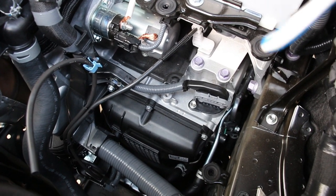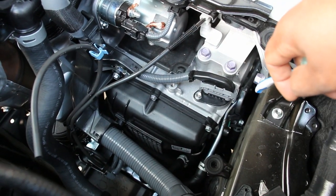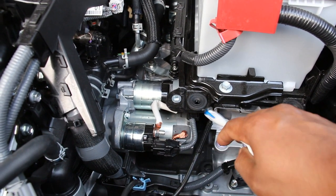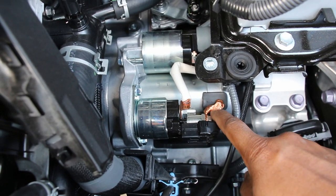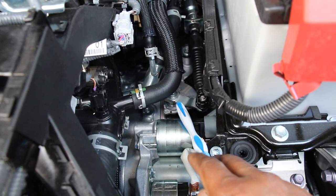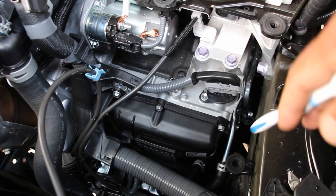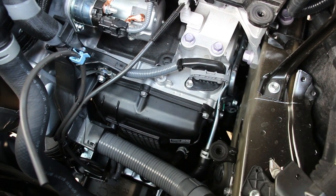Next we'll take a look at this 8-speed automatic transmission in the Highlander. With the air box removed you can see clear access to the top of it here, with this plastic cover being your valve body cover. Just in front of that valve body you can see the two lines that come off and go to the transmission cooler, which is a separate unit from the radiator. On top of the transmission you've got easy access to the starter motor, which is just under this battery tray — you might have to be changing this out soon if your vehicle has the idle stop-start system. Just behind the starter motor is the cable linkage to change the gears, because this has a cable-operated shifter, not one of those fancy electronic ones. What's missing from this transmission is a dipstick, which means you can't check the quantity or quality of transmission fluid as easily — instead there are drain and fill ports, with the fill port located off to the side, accessed from down below.